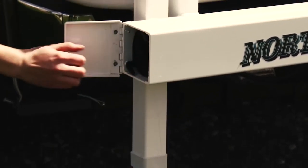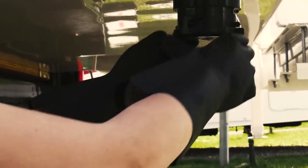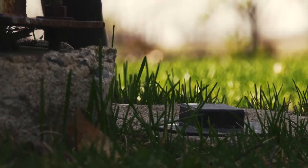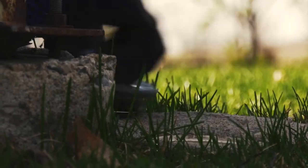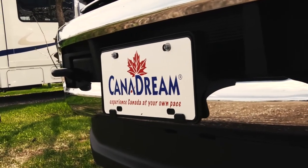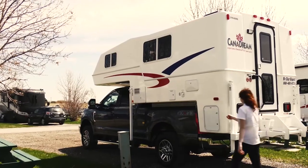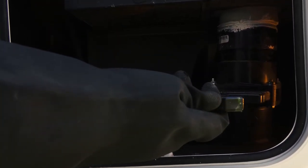The sewer hose is stored in the rear bumper of the camper. Remove the waste hose from the storage compartment. Remove the dust cap from the waste pipe outlet and connect the waste hose. Twist to make sure the hose is firmly attached. Place the opposite end of the waste hose at least 15 centimeters (6 inches), but not more than 30 centimeters (12 inches), into the sani dump. It may be necessary to prevent the hose from extending past the recommended distance by using a foot, the lid, or possibly a rock to hold it. Always drain the black waste tank first. Pull the handle marked black, or the larger of the two handles, until it stops.